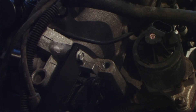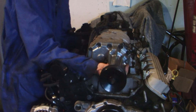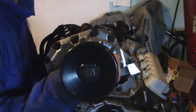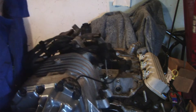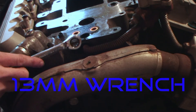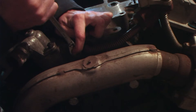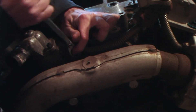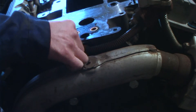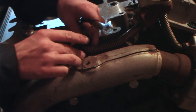Okay, I think we're ready to pull this thing off. And there we have it — I'm going to set this aside and we'll take the lower intake off. Next up is going to be the EGR tube. This will be a 13mm wrench, as a socket won't fit due to the exhaust. It's really nice if you have a ratcheting wrench. If you don't, just be patient. Got that out.